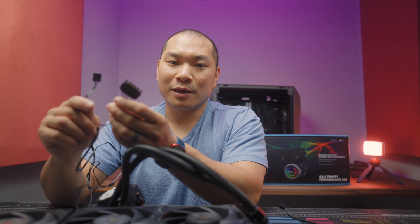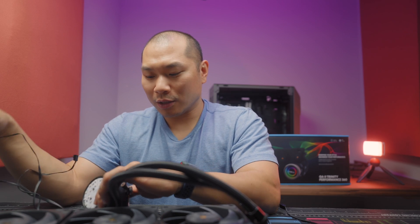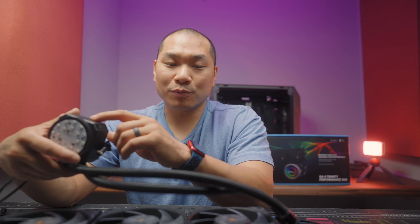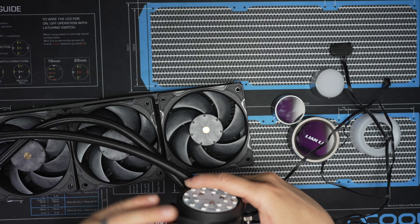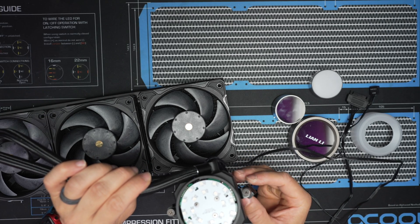To connect to your system, the pump head requires SATA power, and to communicate with your system it needs to be plugged into a USB 2.0 header. Through that you can interact with Lian Li's L-Connect 3 software to change pump speeds and lighting effects. On the pump head there are two additional ports: one connects to the motherboard's 5-volt RGB header if you prefer to control lighting within the motherboard instead of L-Connect, and another lets you bridge L-Connect's lighting instructions downstream to other devices. For Intel sockets, mounting uses a back plate with spacers. For AMD, it uses a two-point solution that hooks onto the stock AMD brackets on your motherboard. You can screw this down, so it should be mostly fine.